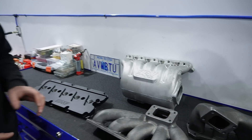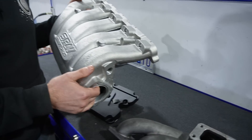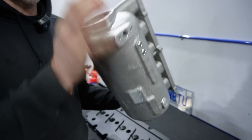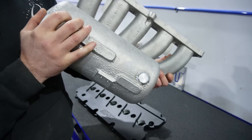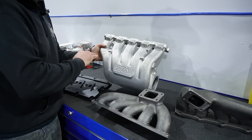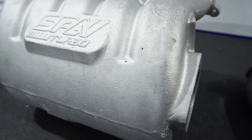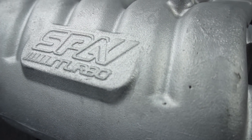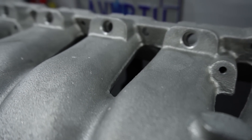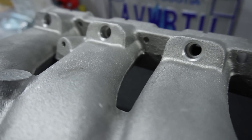And then the last big one — and it is a big one, it's huge. I've got like foot-long hands here and there are additional parts jammed inside there. On its own it's massive and looks very weird, but in the engine bay, much like a 2.5, you're only seeing this much of it, so it looks really at home in there. This sort of intake manifold, if you try to fire one of these on with a stock tune, you're likely probably going to see a decrease in horsepower. But it's not meant for that — it's meant for a proper tune, or in most people's cases, turbocharged.